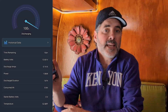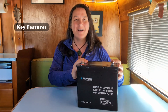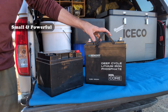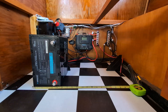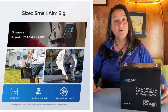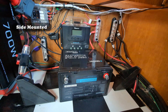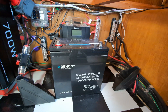Here's the battery at 100%, which was taken on October 20th. Here's what we already love about this battery: at just a bit bigger than our 50 amp hour lithium iron phosphate battery, it has twice the capacity. We also noted that we could fit four of these Mini-Core batteries in the same space as our two Pro batteries inside our camper solar cabinet. This battery is a Group 22NF, which is up to 50% smaller than typical Group 31 batteries. It can also be side-mounted, making it perfect for narrow spaces in small truck campers, travel trailers, and even boats.